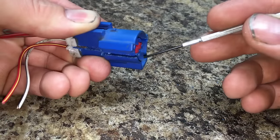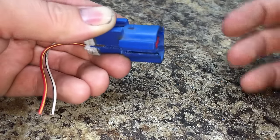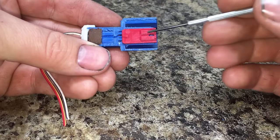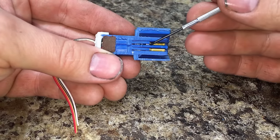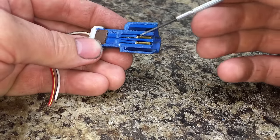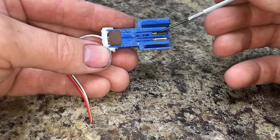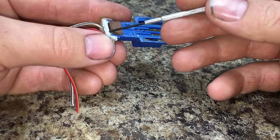What I have here is a cutaway of one of the connectors to show you exactly how they're constructed. You can see the internal locking tab — how it drives in and puts pressure on both sides to lock in the individual locking tangs that hold the terminals in place. It's a basic plastic shell with different design variations so you don't mix them up. The wire goes back through a rubber or silicone seal to keep water and debris out so the terminals don't corrode. Some connectors also have a back cover that holds the one-piece seal in place.